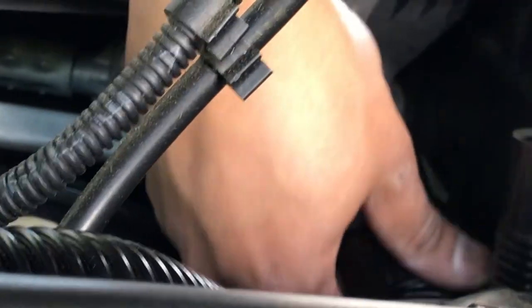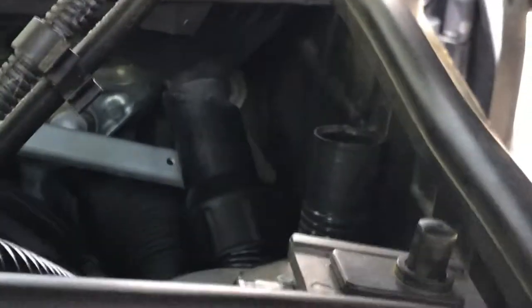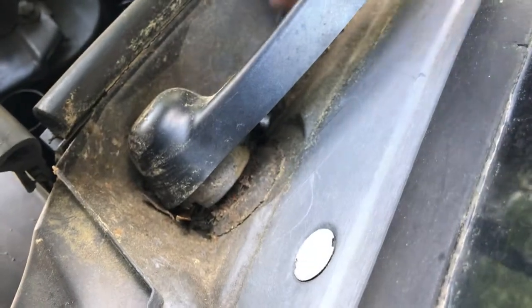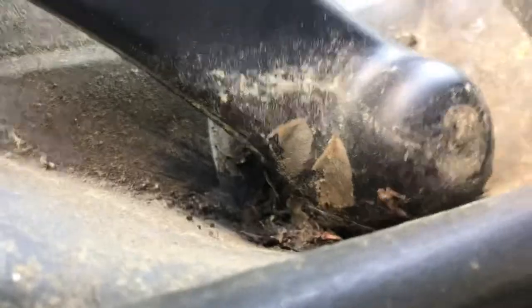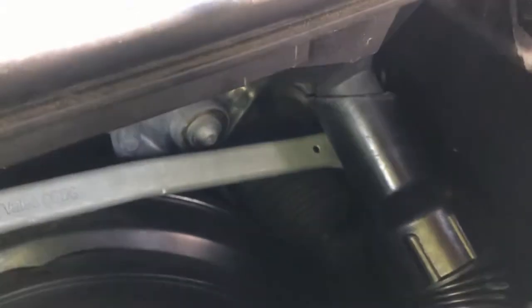I'll wiggle it from back here — it fits right over that spout. Then what you can do is take a little screwdriver or some type of agitator. In this case I'm just using a little zip tie, and you can poke at the base of this drain to loosen those particles. Turn on the vacuum cleaner, and I'm going to agitate all that debris and it's going to get sucked right through the tube with the vacuum cleaner attached to it. Just watch this — it's going to be very satisfying.